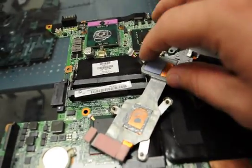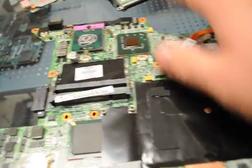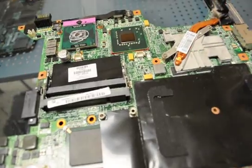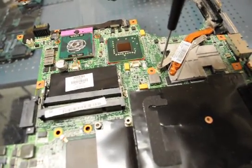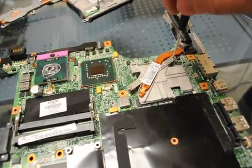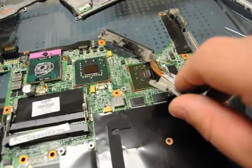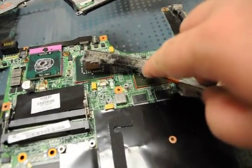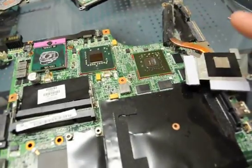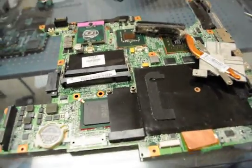What's going to happen is we'll leave this on the way it is, clean all this up, and then we're going to re-flow it on here, re-flow it here, and then re-flow these VRAMs and re-flow that actual chipset. Because underneath this boot, as we've seen with our other system, there's the chipset. One thing you can notice before we take it off is that as we do take it off, what happens is that heat pipe gets clogged. So we'll clean that out also, then re-flow all this, and that'll fix the system up just right.